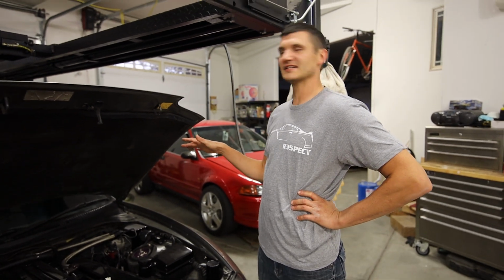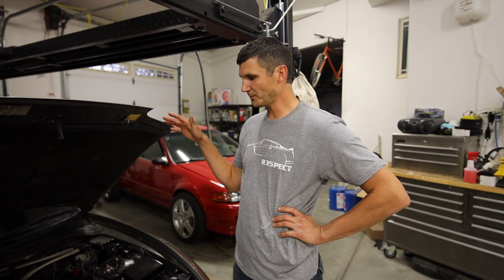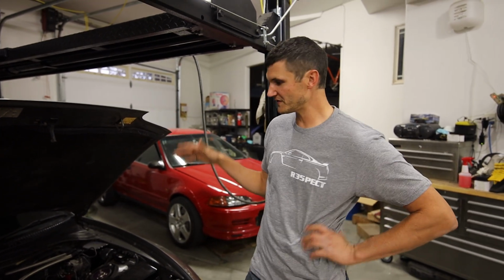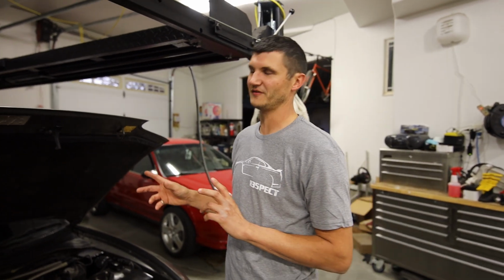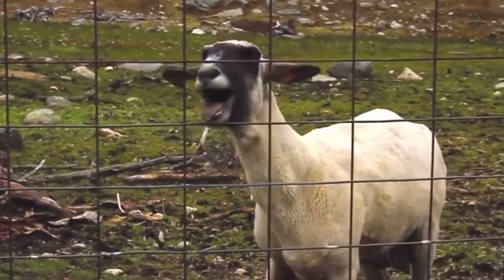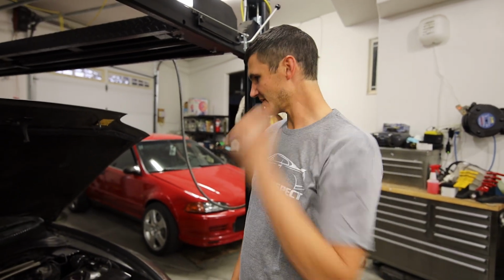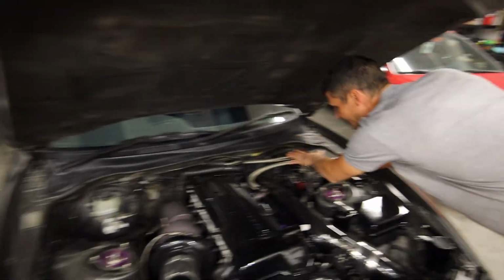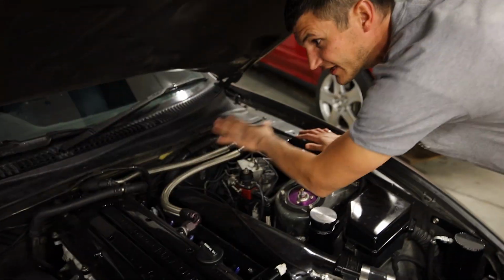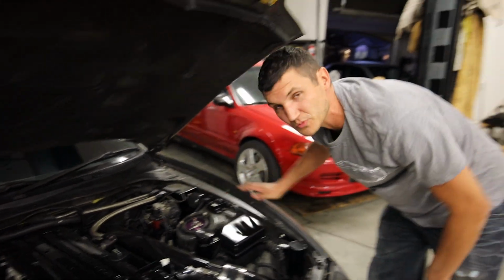It's the Getrag 6-speed turbo transmission, double pumper in the trunk. It's twin Walbro 450s staged. So I staged the second pump in at about 5 PSI. And yeah, typically what you guys are used to seeing is this over there, because normally right here you got the brake booster and everything else, but obviously right-hand drive, so it's just swap-a-roo right there.